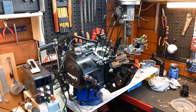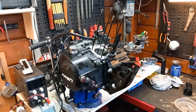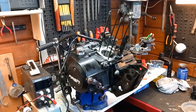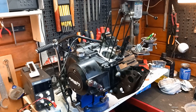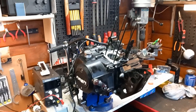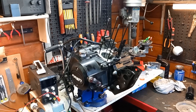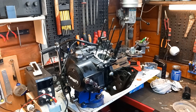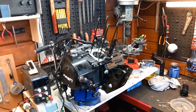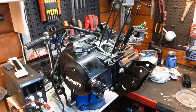I'm in my small shed in our backyard and there it is — the exact same engine. We're 400 kilometers in and something has failed. Last weekend I was driving, my son was a passenger, and we had a strong headwind. The bike couldn't make it up into the wind, eventually we got home, and the engine stopped. I could not get it started again. I checked the valve timing, ignition timing, and all, and couldn't see anything obviously wrong. When I tried to start it, it seemed the engine had lost compression. Worst case scenario: I blew a hole in the piston or had a valve problem. I took the engine out — otherwise you can't lift the cylinder head off — and now it sits here on the bench, and I found the culprit.